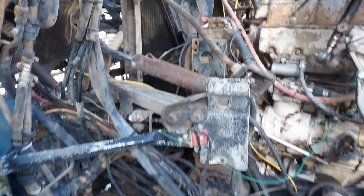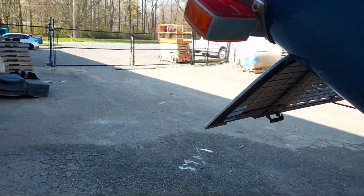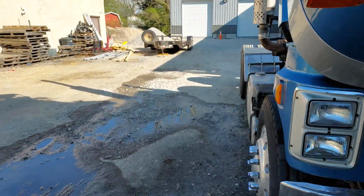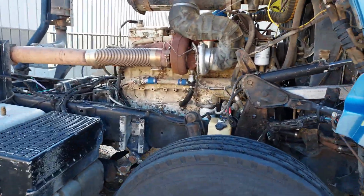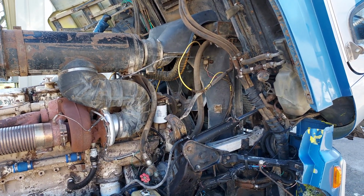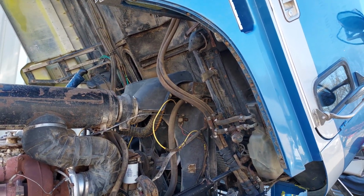Another thing that somebody's hacked up in the cab is the HVAC controls. The heater switch is no longer operable, but somebody's put a little toggle switch in that turns the fan basically. I mean, they did do it where you got at least 2 different blower speeds, but still not factory. So I assume the heater switch is probably bad. So see if I can source a new heater switch for it and get that wired back up how it's supposed to be. But like I said, I'd like to get the HVAC system working as well.